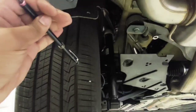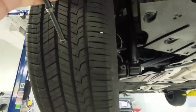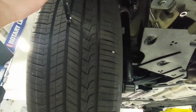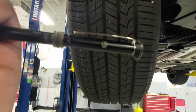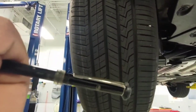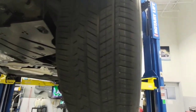First on the MPI, I'm going to be taking measurements on the tire treads, measuring in three places. First will be the inner tread — we are at 13 millimeters. Next, the middle — looks like a little over 11. And lastly, the outer — getting close to 12. During the measurements, we also want to be on the lookout for any punctures to the tires and note that down.